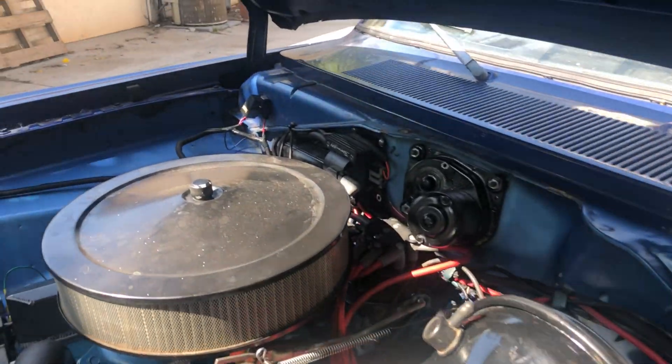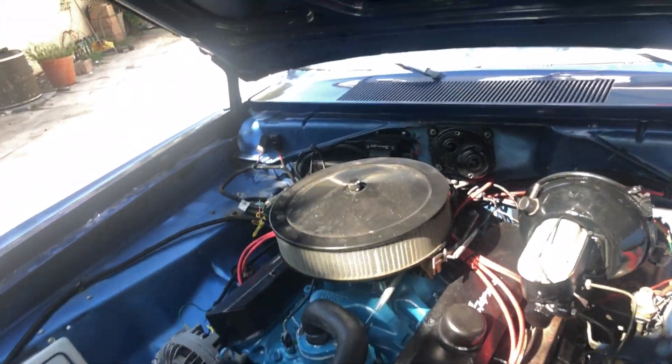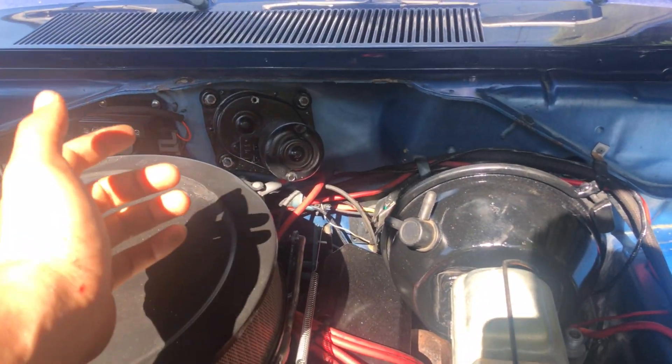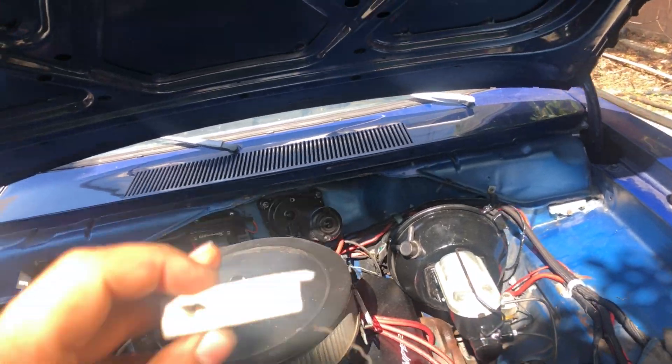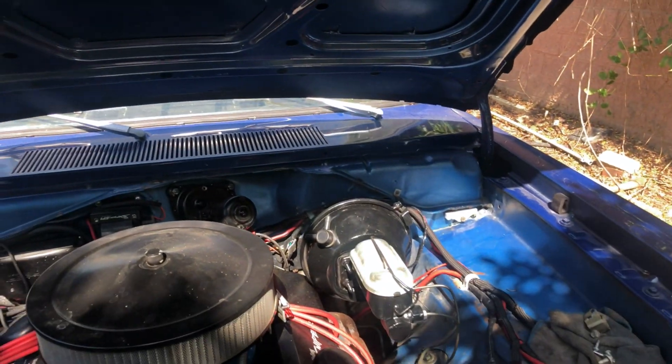The car has the Painless wiring harness — the previous owner was doing it but looks like he didn't finish some parts of it, so one of the parts is the wiper motor. It had a ballast resistor on top of it like this, but mine broke — it's mounted right there with the strap.